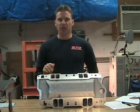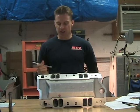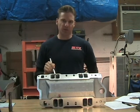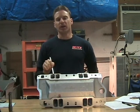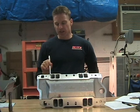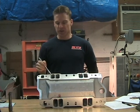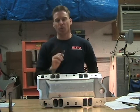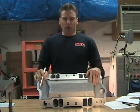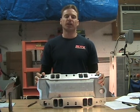If you're just going up one port size, you may only gain 20 CFM, so what was achieved here may not apply across the board. Also be aware: make sure you match this port to whatever your cylinder head is. If you expand this port but your cylinder head is at 200cc, you haven't achieved anything — the air hits the edge of the wall and all that extra work is for nothing. That's the end of this section; next we move to Step 2 for your next greatest gain.